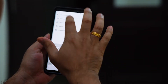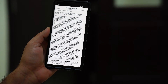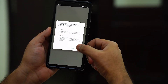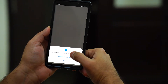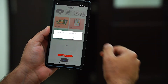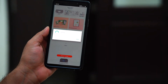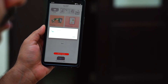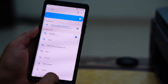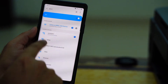Now let's start setting up the smartphone. Go to the Play Store, install the Canon Print app, agree to the terms and conditions, and when you go inside the app, allow it to access your location and photos, and start searching for the printer. The problem is it might not be able to find the printer directly — first you have to connect to the Wi-Fi of the printer itself. The actual internet will not be there; you connect to the Canon Wi-Fi.